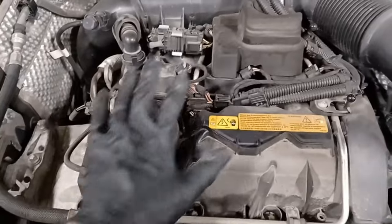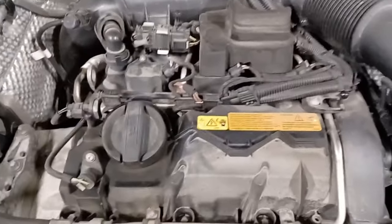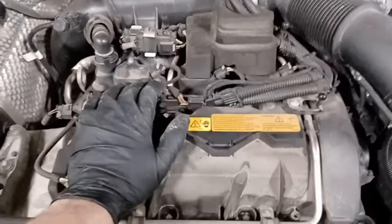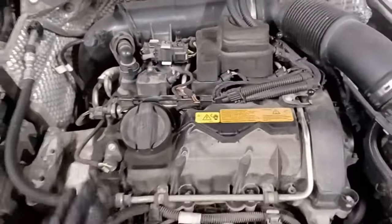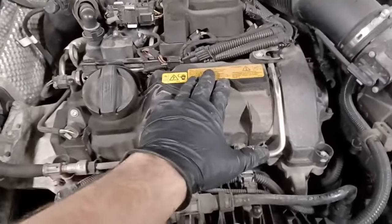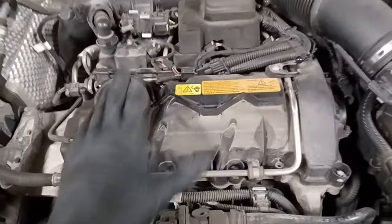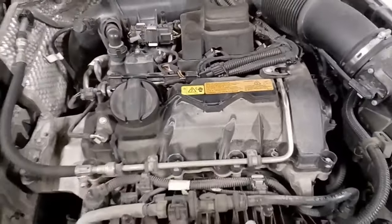We're going to start by, we've cleaned this, we've got compressed air on to get all the dust off. Essentially, we're going to take the injectors out once we've stripped all this sort of stuff out of the way. Move the fuel rail, take the cam cover off once the injectors are out, and then we're laughing. But of course, then we need to time it up, and once we've timed it up, we can start by undoing the Vanos wheels and we'll inspect them. So let's get cracking.